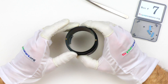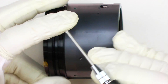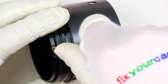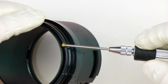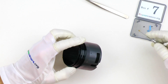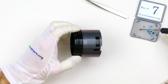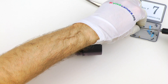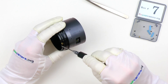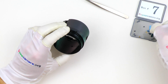Under the front plastic ring there are two brass rollers, and this is also not the type of design I love to see — secured by small screws with tiny threads into a thin aluminum piece. I don't want you to worry about this too much, but I hope you can see why you should be gentle with the clutch mechanism on Tokina lenses. Especially if you are in manual focus mode — there is a point where it stops. Don't force it past that point.